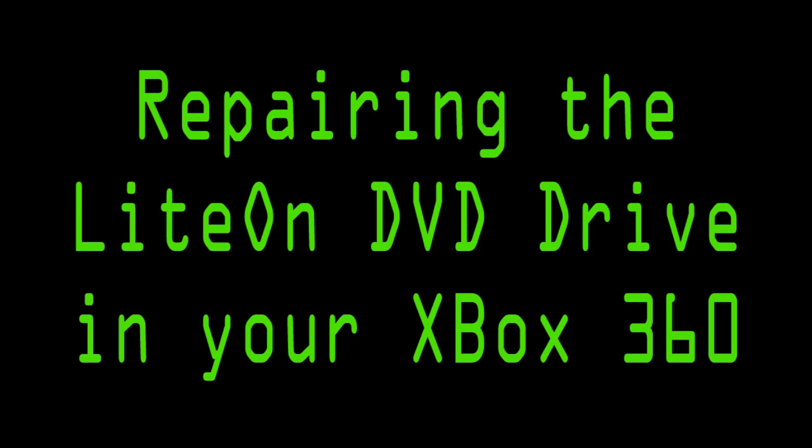Remember, this is specific to the Lite-On Phillips drive. If you're having problems with your DVD drive on your Xbox, you can identify it through the trays — there's plenty of tutorials to show you how. I like to take it apart and get the part numbers off the DVD drive to make sure I'm getting the exact part I need. Also, never ever have your Xbox plugged in while you're working on it, especially when disconnecting components like your DVD drive. If you disconnect the DVD drive while there's power to the Xbox, it's going to trigger a mechanism that detects tampering and it'll be banned from Xbox Live the next time you get on.